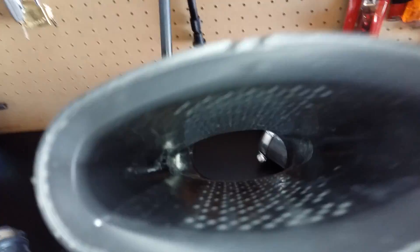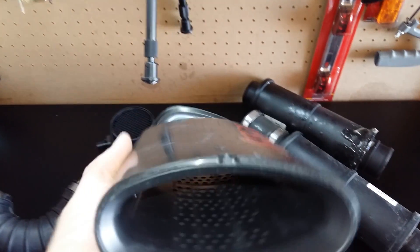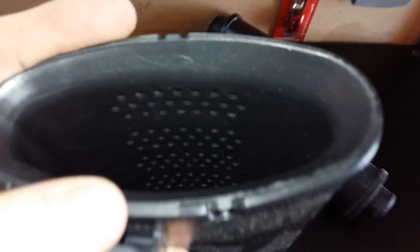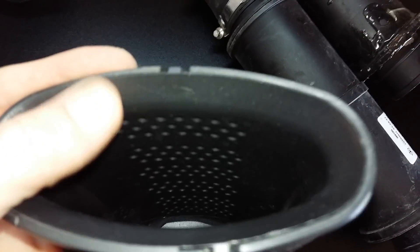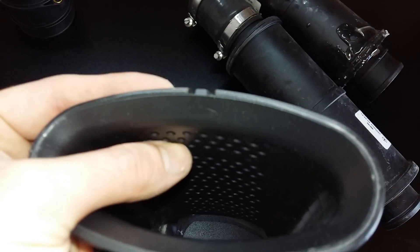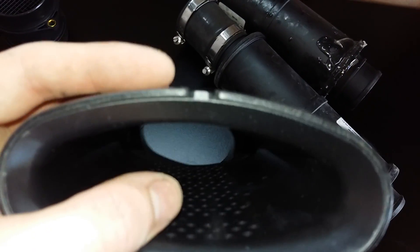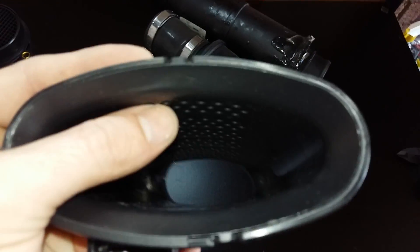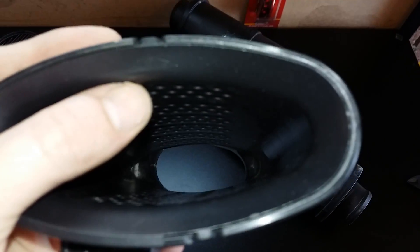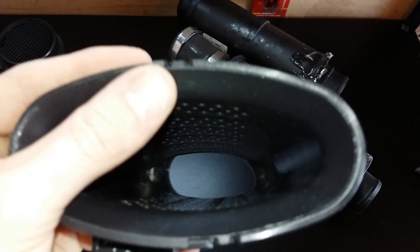This is the breakaway of the tube right here, so you can see the restrictor portion — how it is restricted there, how it comes down, and it pinches off the airflow a little bit. These perforations here help to drown out some of the intake noise, and you don't hear the turbo whine like you would think. Even without this device, the only thing you hear is the actual air whooshing through the air tube. So this is what goes into the turbo.